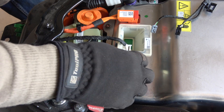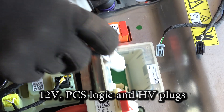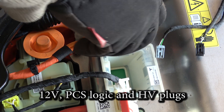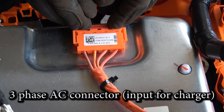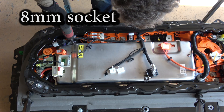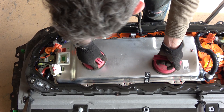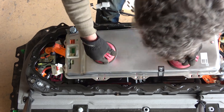Disconnecting the low voltage battery connector — just a simple push-down pull, then pull the locking tab to allow you to push and wiggle it out. The PCS is a combination of things: it not only charges the high voltage battery but also charges the low voltage 12 volt battery, and it actually uses the 12 volt battery to pre-charge the circuitry to bring it up to high voltage.